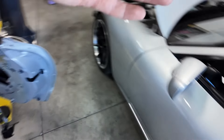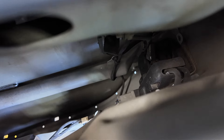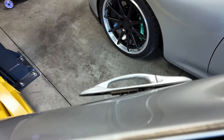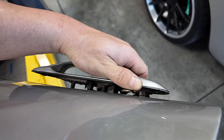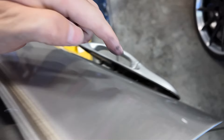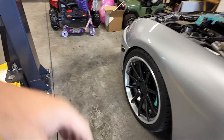I did a really in-depth video when I did her car. It's just two tens here. To get this one out it's best to just pull the door handle - you go through this hole here and the other one goes through here. If you look down in there you can't see a whole lot, but that's what the door handle is. When you pull this out you might have to push your hand in here and just push up on these little plastic clips. This little locking mechanism needs to twist out.